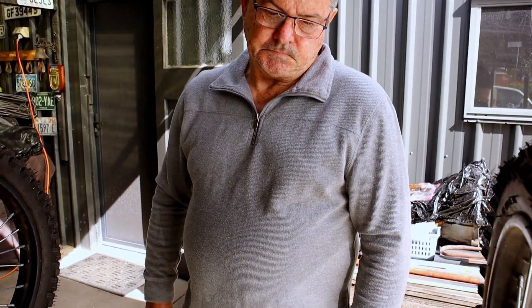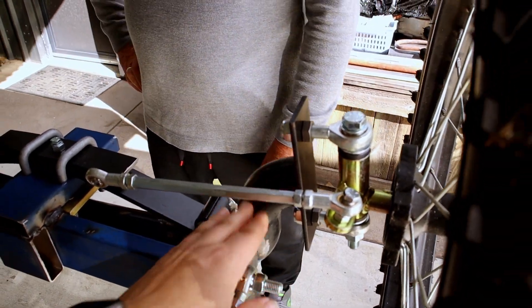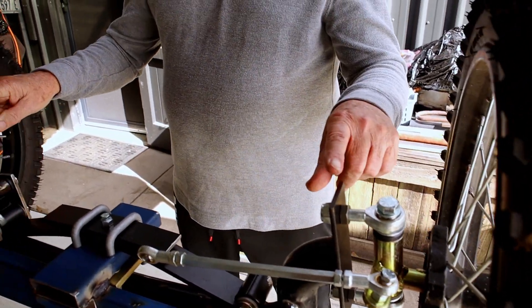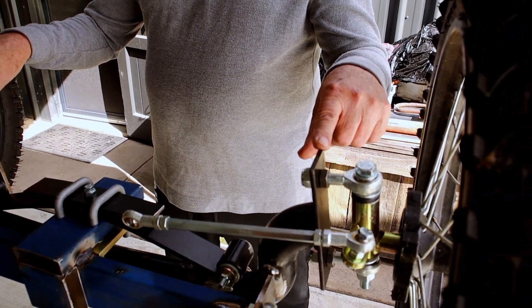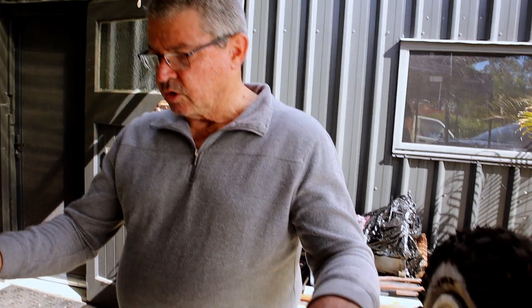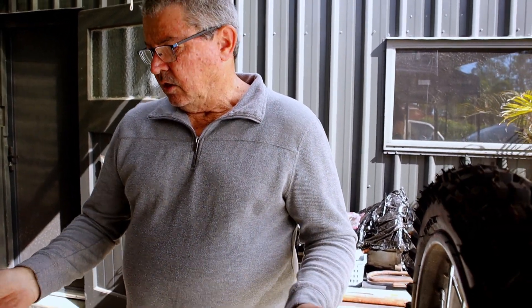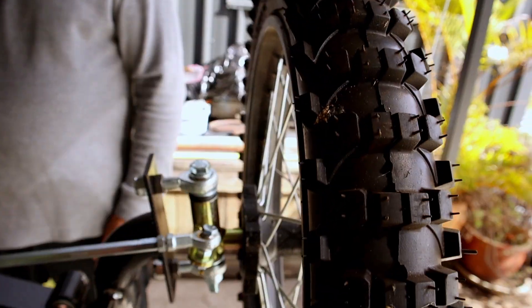Last week we were showing people you had fabricated the front axle. Yeah, I built the front axle, and then during the week I manufactured all the components to fit it all together — the shackles, the spring hangers, the radius arms — and bolted it all together so it looks the way it hopefully should finish.